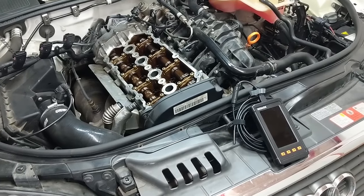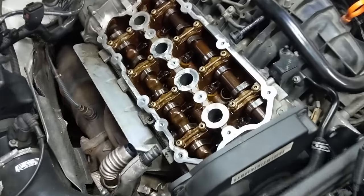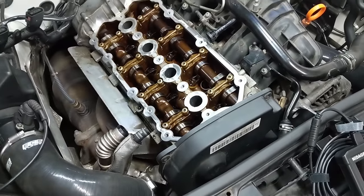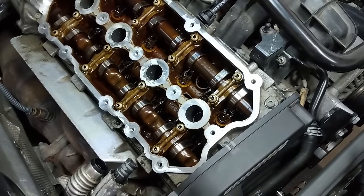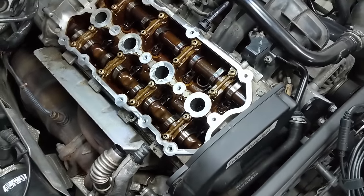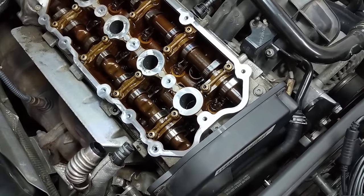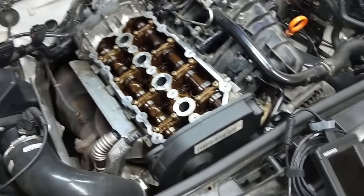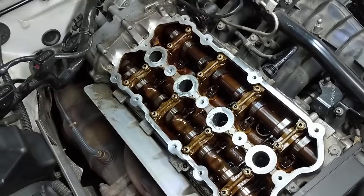This final part of the baseline test is going to be really interesting for two reasons. I want to rotate the assembly to push each piston down towards its relatively bottom dead center using a socket and wrench on the crank pulley. With the valve cover off I can actually watch the lobes push down the intake valves to know where the piston is at. Once each piston is down, I'll look at the sidewalls normally under the oil ring to see their condition. Also, because we had the compression issues, once the intake valves are pushed all the way down I'll use a borescope to try to look at the top side of the intake valves and see if there are carbon issues.